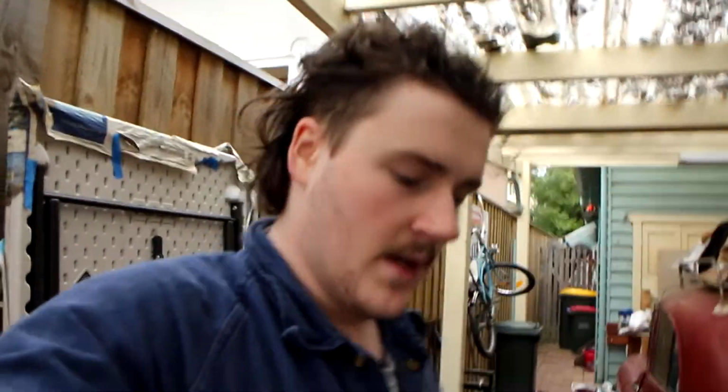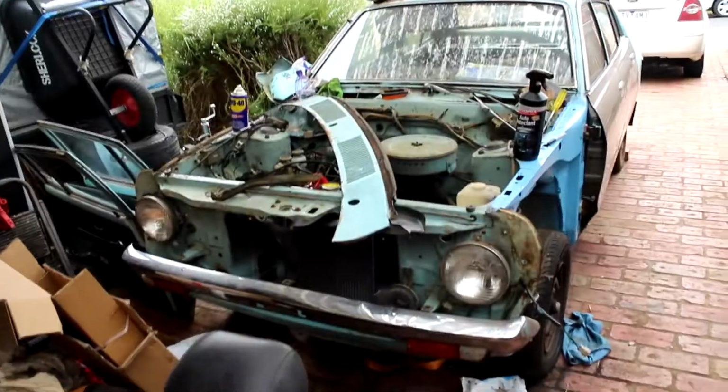but other than that, it's pretty good. I just went to it with a wire wheel and it came out fine, just painted it, but I did have to take the grill off and unbolt a section of the bumper. I took off the headlight and then realised I didn't need to. But yeah, it's off, and I've just got to do that on the other side. The guard's already off, and then I just switch the front door on, and they're straight, it looks good.